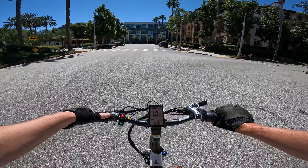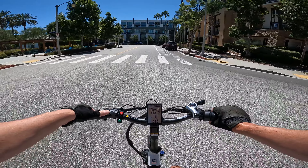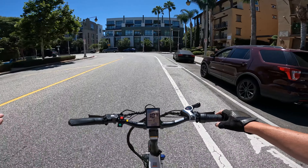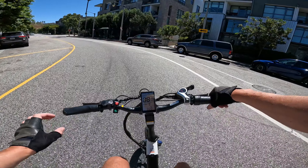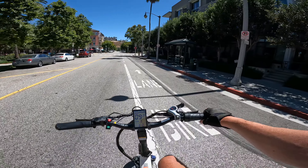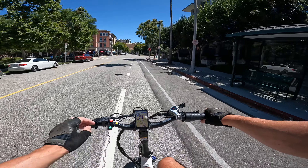Hold the minus button and cruise mode activates — it says right there on the display. So we are on cruise control, ladies and gentlemen. Nine miles an hour, pretty sweet. If you don't feel like pedaling, you always have cruise control. Putting it on pedal assist two bumps up your speed, and to deactivate cruise, you just tap a brake lever.